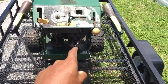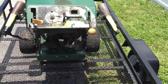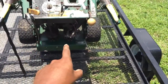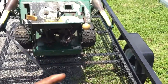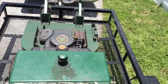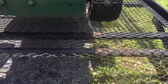The parts diagram for this mower says it needs a 49-inch belt — that is not right. It's too big. You don't need that. A 47-inch is the highest belt this mower will take. If you get a 49-inch belt on the engine's transmission belt, it will not make this mower move. You need a 47-inch or less — between a 47 inch and a 44 inch. Anything bigger or smaller than that isn't going to work.